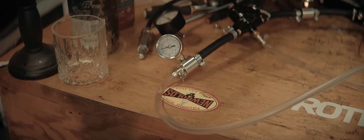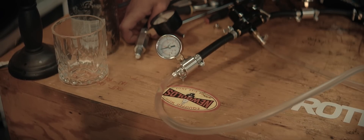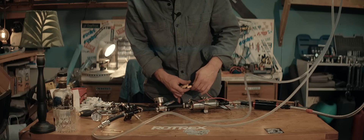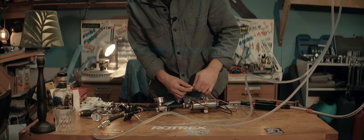Pretty much at maximum now. I'm starting to think my high pressure pump is not working — I think the pump is dying. We need to get another one. I can't see any pressure even if I pinch the return line. There's not much pressure to speak of — like half a bar.